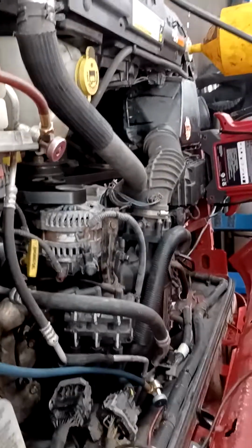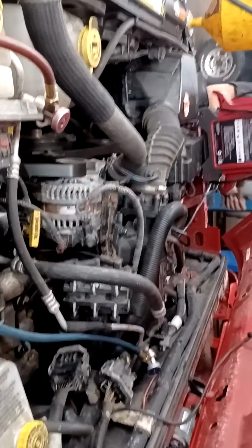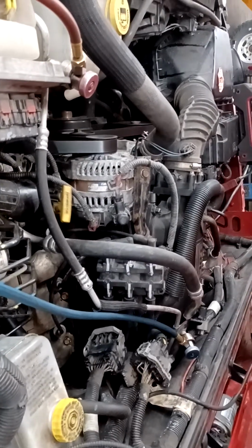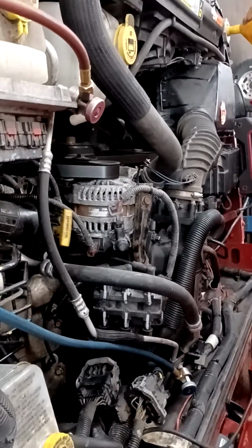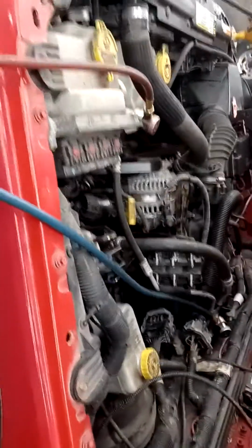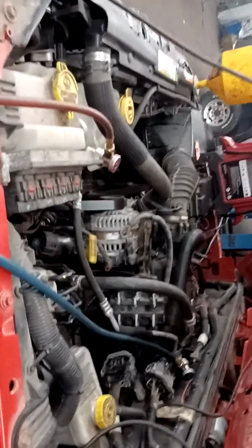So we took it all apart, and with the oil filter housing off of the Caravan, we could see there was a boss in the block that was being used that wasn't being utilized on the Jeep, and it was all rusty and plugged up on the Jeep motor. Once we pulled the front covers off, that showed us that the hole being used on the Caravan was actually blocked off for oil passage on the Jeep by the front cover, and it just came into the filter housing on the Jeep for the oil filter that mounts on the front cover. That was really the only major thing outside of what you would expect. We had to change the motor mounts over, but the block was the same for the motor mounts to screw up. We swapped the intake and exhaust manifolds, that type of thing, and it's in there, it's running, it's purring like a kitten.